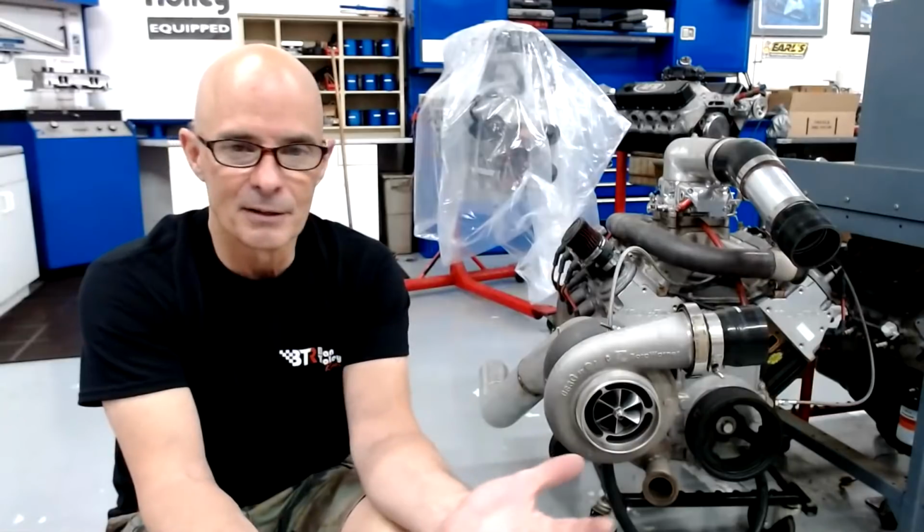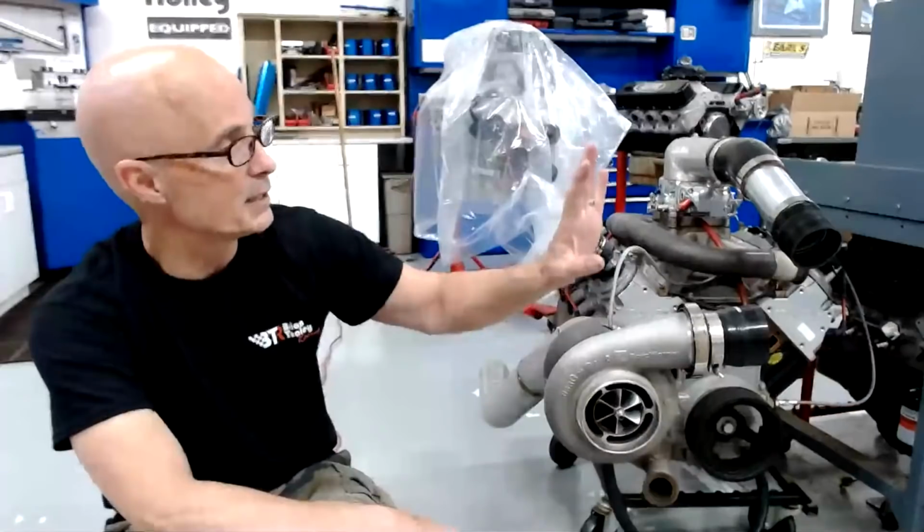So it was nothing radical, but we would run it and tune it, and when we would run it out at Bonneville, we would put ice water in. So when we did the tuning on the engine dyno and on the chassis dyno, I had to make sure that we tuned it with the ice water in it, because it makes a difference. It wants to make a lot more power, and it sounds so much better and so much happier when you put the ice water in.